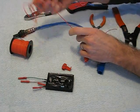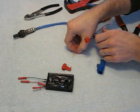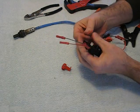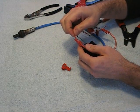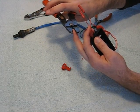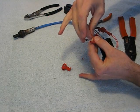Then you'll run the hookup wire back. If that's connected to the O2 sensor side of the circuit, you'll bring it back and attach it to the input going into the enhancer. To do that, just strip a little bit of the wire — maybe a quarter to three-eighths of an inch. Place it into the crimp terminal as far as it will go. Take a pair of wire strippers — there are two settings on the end: one for a wide crimp and one for a narrow crimp. Take the one for the narrow crimp, squeeze it, crimp it, and the wire is attached.